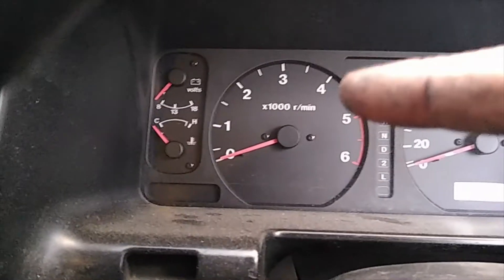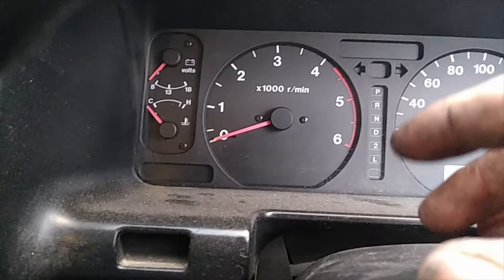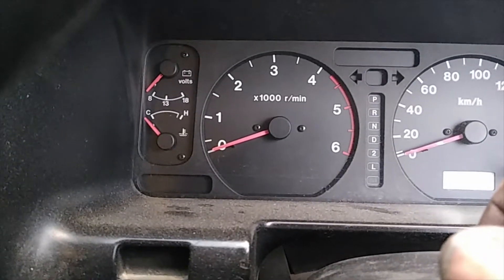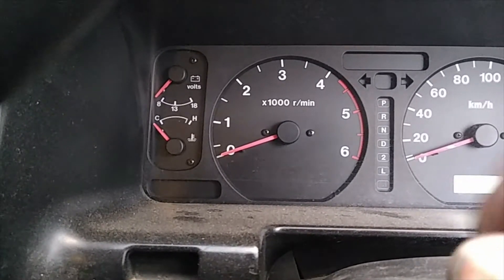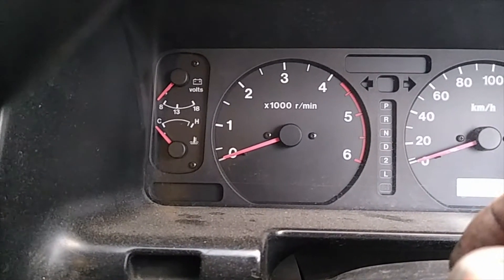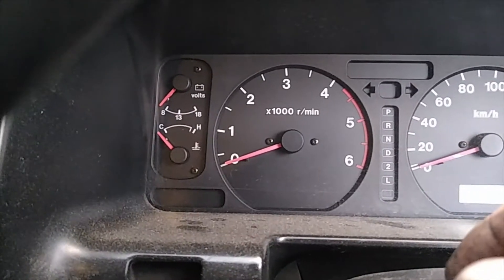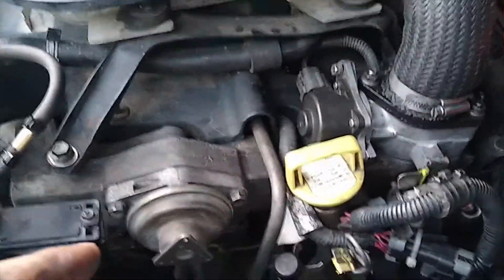One observation: I just turned the motor off and it gave a little bit of a shake as it turned off. From what I've read, that's quite normal because the throttle plate would normally shut and actually stops the engine shaking a bit on shutdown. But I don't care — it seems to run well.